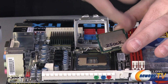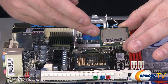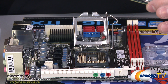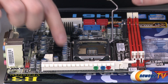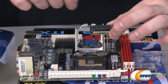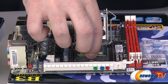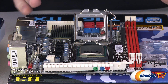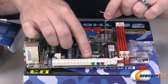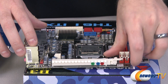Bear in mind the CPU is going to have a couple notches on either side — this is an LGA 1155 socket, and this should also account for LGA 1156 sockets as they are all going to be very similar. Simply bear in mind where those two little notches are, as they will line up with notches on the socket. You can also reference the triangle on the corner of the socket — there's a little triangle right there that will line up with the triangle on the corner of the CPU. You want to drop the CPU straight down. If you hold it by the front and back, there are spaces on the socket that give you a little more room. Just drop it straight down — you don't need to push down, that will be handled by the bracket itself. Lower the bracket and it will be guided into the notch at one end. At this point you will need to apply a bit of pressure to get the arm to drop all the way down, latch it in place, and then you're all set.